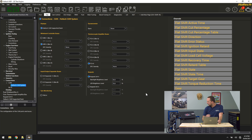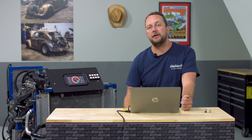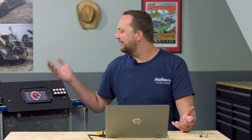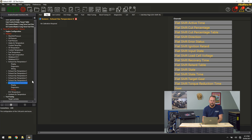We've also got a dual wideband controller set up here. Just because it's my test engine, I've also got a second wideband controller to test any wideband or firmware changes, or set up a different ECU that doesn't have an internal wideband controller. For the example, I'm going to add an 8th EGT to this engine — it's only a six-cylinder, but we'll add the 8th one. So if I come up to the top and go to Sensors, I'm going to turn on EGT 8. Then I get a whole bunch of red error messages. Exhaust gas temperature 8 — first thing, no calibration required. Because this is a K-type thermocouple, with the dissimilar metals, we know the voltage it outputs and we know the K-type thermocouple amplifier is doing its job. So in the engine management system, no calibration needed.